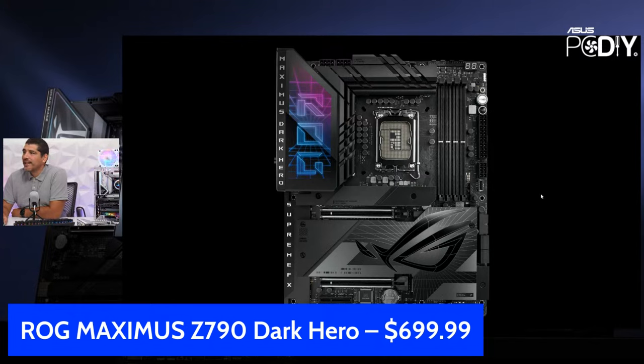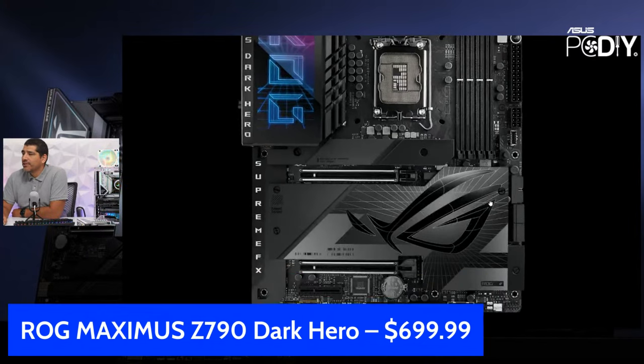So you have the Polymo lighting display, you have the 60 watt power, right, for the internal USB-C, which is going to be utilizing the Quick Charge 4 Plus technology. Of course, you're going to have robust PCIe NVMe M.2 SSD support. You'll also notice things like dual front USB 3 internal headers. That's pretty much a rarity amongst motherboards. Most motherboards only have one internal USB 3 header, but most chassis only have one USB 3 header as well. So this is kind of more targeted towards higher end boards.